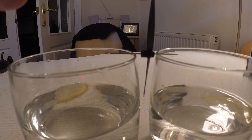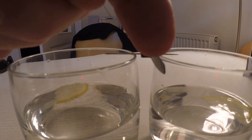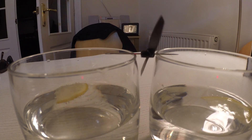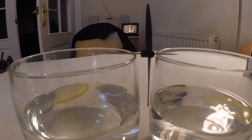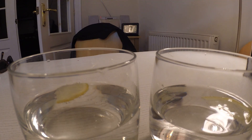Push the top blade down so that it is parallel to the table and let it go. You can see that it swings back quite markedly, and that means the lower blade is heavier than the higher blade. So what you need to do is sand down the heavier blade.